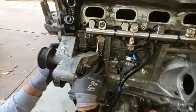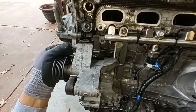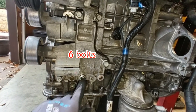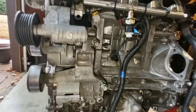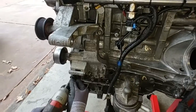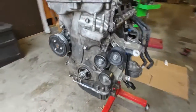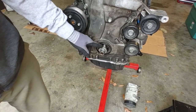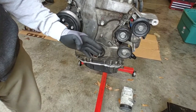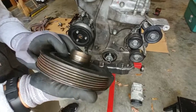Now we're putting on the pulley bracket assembly to support the alternator and the AC compressor. This is a unique bolt that ties into the bracket right here — just hand tighten that. We're not going to install the pulley until after the engine is in the car and mated to the transmission, because the pulley extends outward and it's difficult to wiggle the engine onto the transmission with the pulley on. So we'll put the pulley back on during engine installation in the engine compartment.